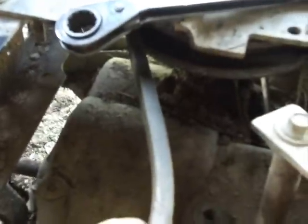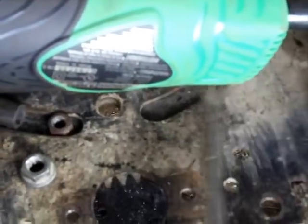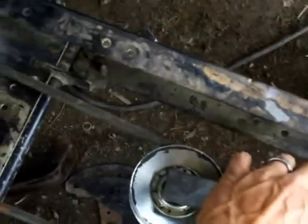What I need to do is pull this belt this way to make the most contact as possible with the rear pulley, to get as much friction as I can. But at the same time I can't pull it too far, because where these two holes are is where the steering gear drops in and bolts in, so this belt can't come over any further than right here. The double-pulley clutch — which I've partially made so far — one pulley is flat and one is a V. You can see how one pulley pushes the belt that way and the other pulley pushes the belt that way.